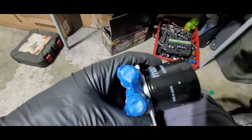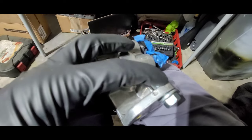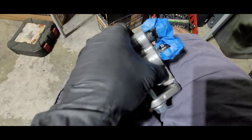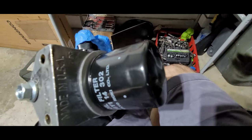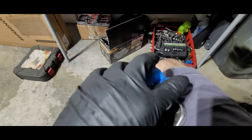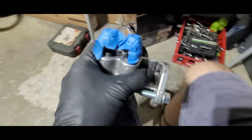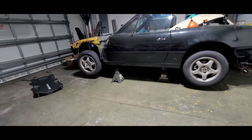And the reason I have tape here is because since I'm sitting it on the rack, these holes are a little bit small. So I did have to drill this hole a little bit bigger so that the bolt will fit. Keep in mind that's what you might have to do if you're gonna relocate it somewhere where a bolt is a little bit bigger, but it's fine. All you have to do is make sure that everything is nice and plugged and sealed, that you have some sort of filter there, or even a used filter is fine just to cover it from having any metal shavings. Then put tape on these ports and drill away, and just make sure that you clean it well with mineral spirits or even some isopropyl alcohol should be fine. So then it should be sitting something like this onto the rack, and let's go ahead and finish installing this.